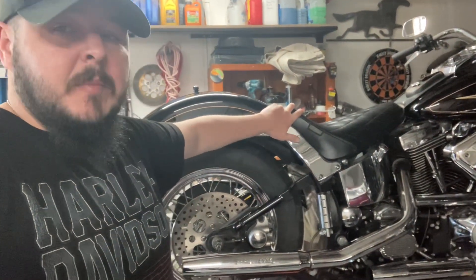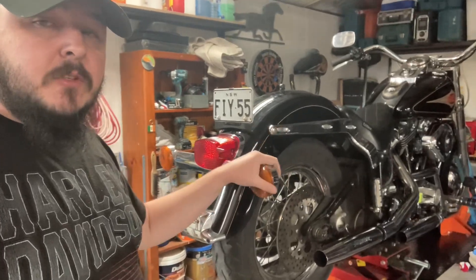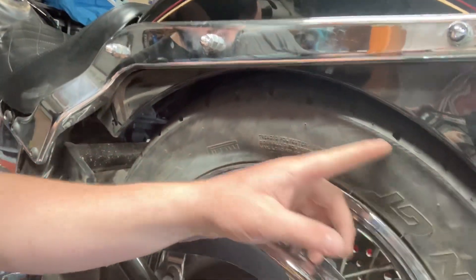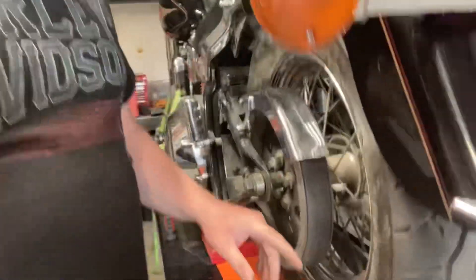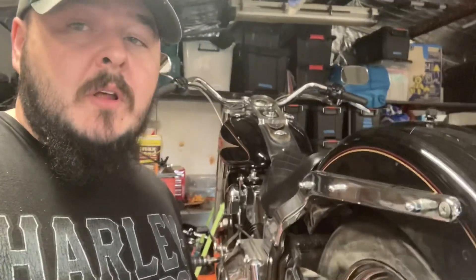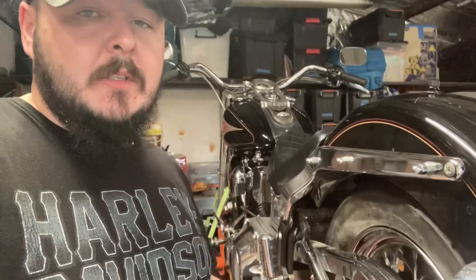The good thing — the one thing I picked up when I had her up here — everything's pretty much good, other than the back wheel. I don't know if you can see this black line here, but you can see these scuff marks coming down the way. When I put the bike up on the lift, the back wheel was rubbing off the belt — they were just touching right in here. It's hard to see, but they were just touching. The reason it was touching is the back axle wasn't properly aligned, so I had to realign the back axle and take it off a bit.